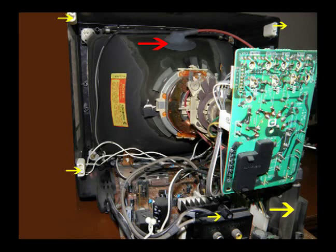In this photo, the small yellow arrows show where the five screws that hold the back case go. The large yellow arrow shows the transformer, and the large red arrow shows the high tension cable that goes to the tube. For safety's sake, you need to discharge this — you can Google how to do that — if you're going to be in contact with this area. I was careful to avoid this area so I didn't discharge the capacitors. Be aware that that's very high voltage, and high voltage will be present even with this television unplugged, so be very careful.